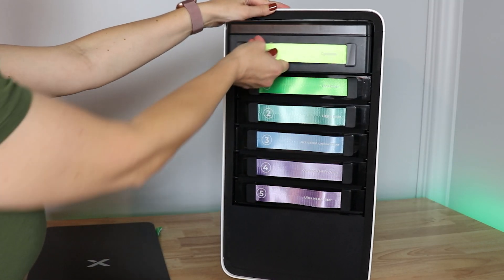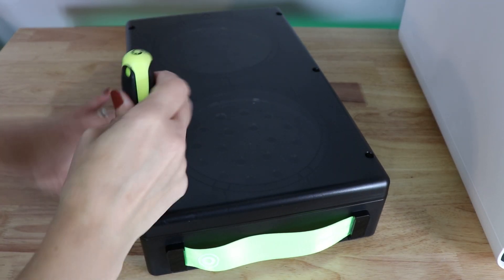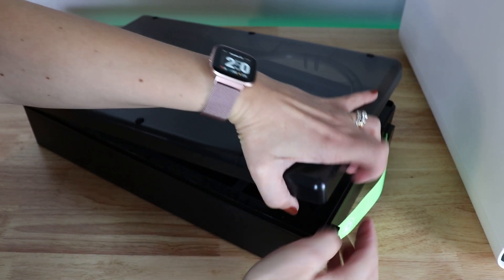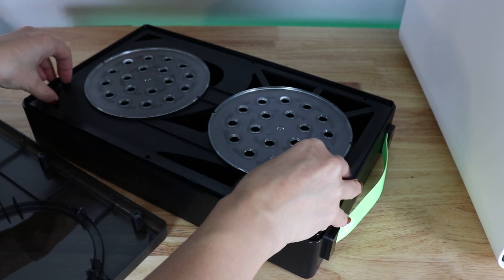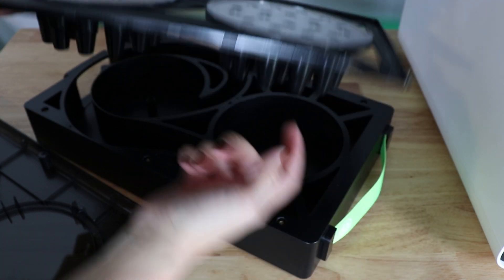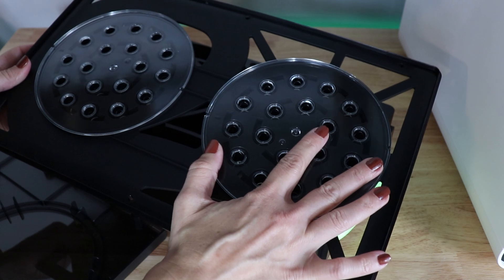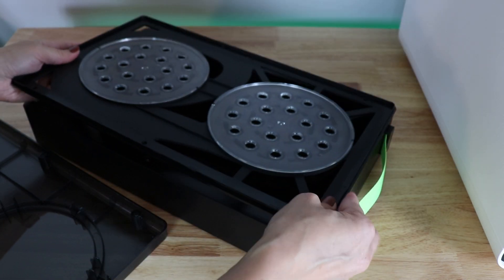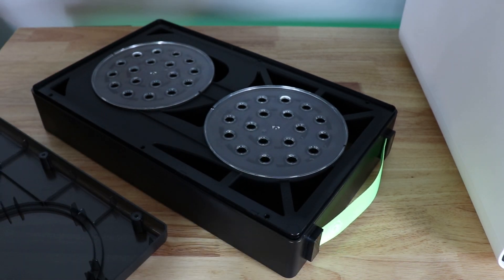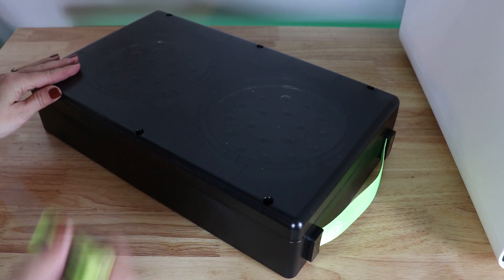Let's pull out the cyclone and take a look. On the very top you can pull off the cover — this is the cyclone catch. The dirt being pulled in actually pools in here, and these will get really dirty. You can take this whole piece over to the sink and wash it off. This really eliminates the need for an extra filter and saves the life of the other five filters, because the big particles of dirt are caught here and washed down the drain. You can check that periodically and clean it up, then just put the screws back in and stick it back in the machine.